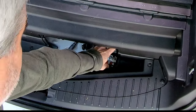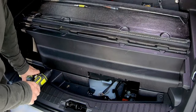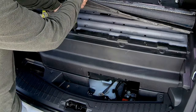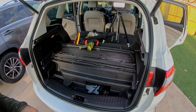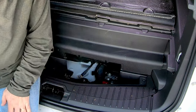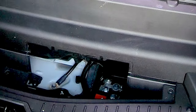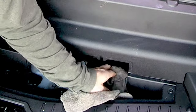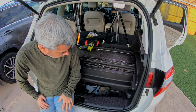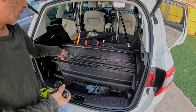Let's get our first look — the battery is right there. We have T30 screws — one, two, three, four — across the top, and everything down here is T25, so let's put those in the driver and spin them out. Now I can see right here the 12-volt power leads, and if I'm using a tool and I drop it across there I can short between ground and 12 volts. For simple safety — something I didn't see anybody else doing — I'm just going to throw a rag right on top of the battery to prevent any possibility of arcing until we get all this plastic out of the way.